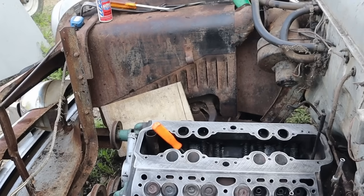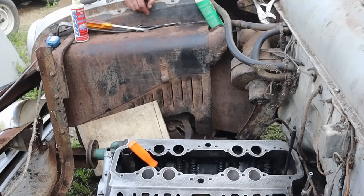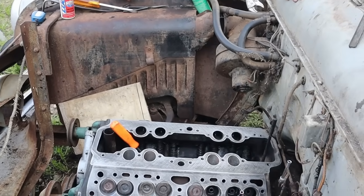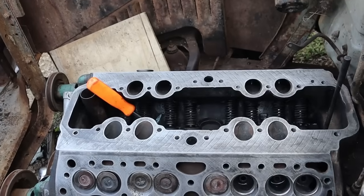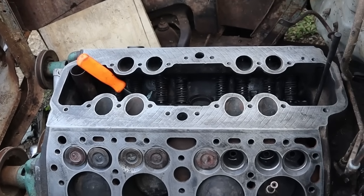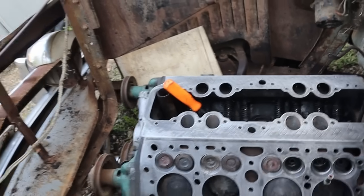You can certainly tell that the guides should come out to do this easier. Oh yeah. This is not the easy way to go about putting valve keepers back in, but they are going. Oh yeah, we got a system. It's just a little slower. So you've already cleaned all the cylinders out? Yep. Yeah, we're ready to put the heads on as soon as this is in.